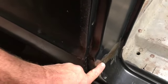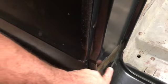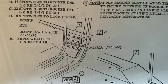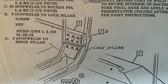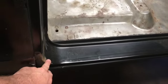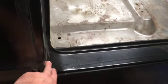But underneath where you graft it in, or where I grafted it in, there are six spot welds here. Factory does spot welds. We have to do plug welds. So there are six plug welds in here underneath this panel. So it would be difficult to change this bedside without changing the outer rocker panels as well. Lots of grafting in to do here.